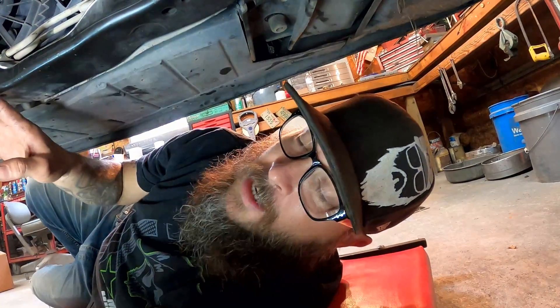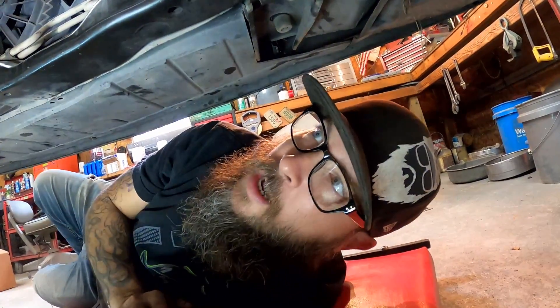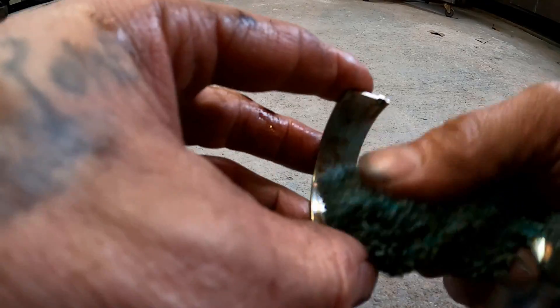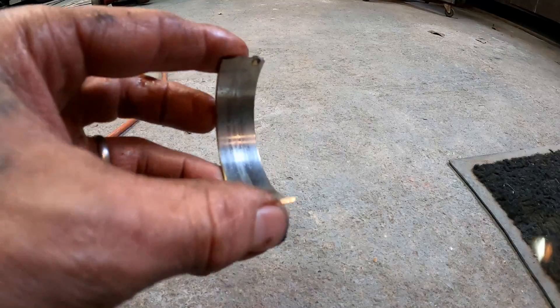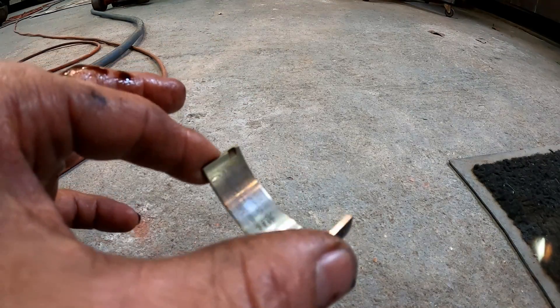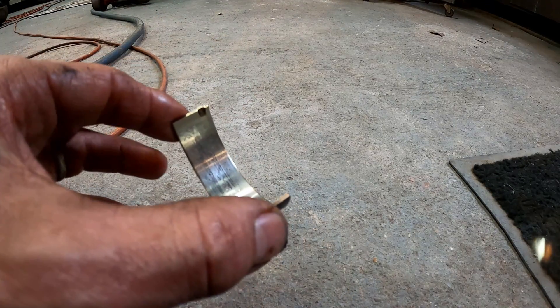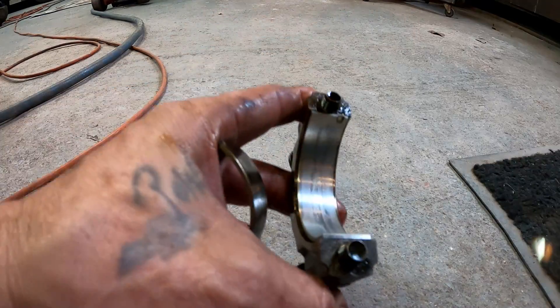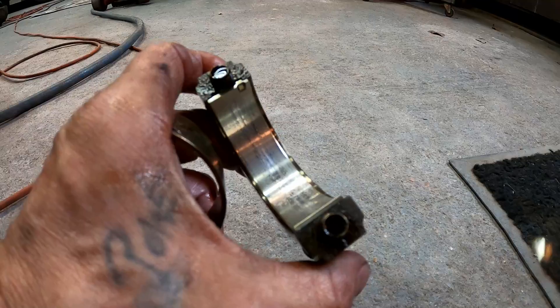So we're down to the last two. We started at the back of the motor working our way forward. If I find any more bad ones I'll let you guys know. Good news - the next set of bearings are just fine. They've got a little wear to them but nothing crazy, they're not welded to the crankshaft or anything silly like that - just normal wear. We'll get those swapped out just as well. We're not out of the woods yet, but at least it did get better and we didn't have any more of those bad ones.